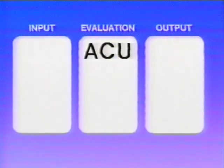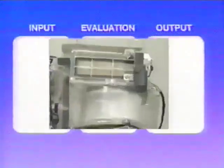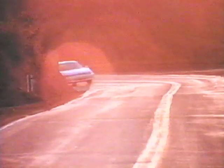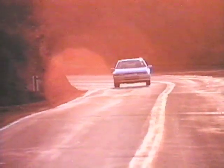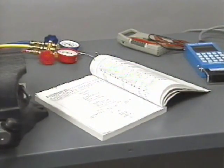At the heart of the system is the auto control unit. The ACU has control of compressor displacement, air intake, air volume, air temperature, and air outlet modes. Some operating conditions, such as hot and cold start-up or extreme ambient temperatures, may have an effect on certain system functions. Always refer to the service manual for additional information.